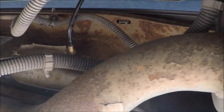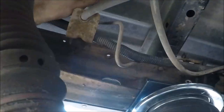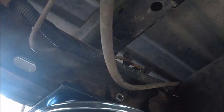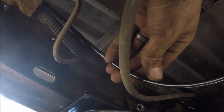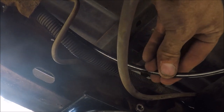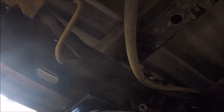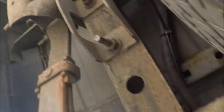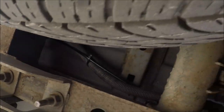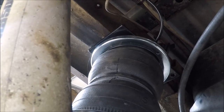Underneath the vehicle I'm going to run the line. I found a wiring harness up here and I'll trace the line all the way across it. The fitting is just a push fitting — once I get the line to the desired length I cut it with a sharp razor blade or airline cutter, making sure it's a nice square and clean cut, then simply push it straight into the fitting and it's connected. With the lines all run and plugged in, I've zip-tied them up nice and tight and out of the way of anything hot. Let's get the wheels and tires back on and see how everything works.